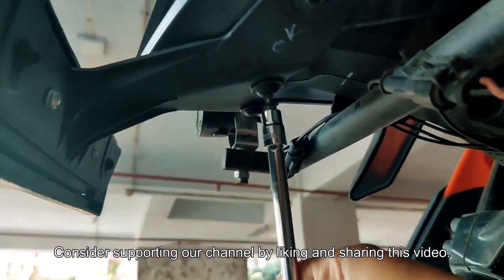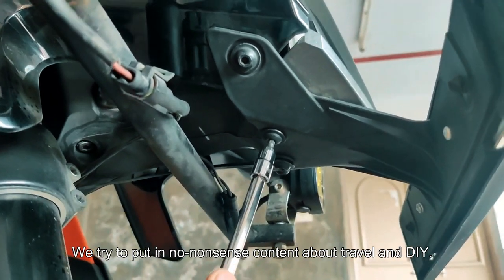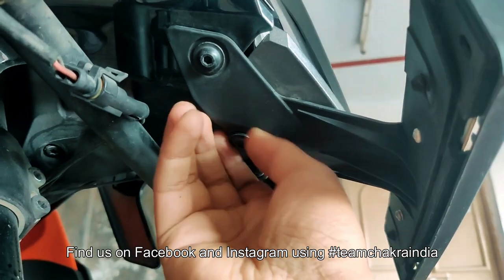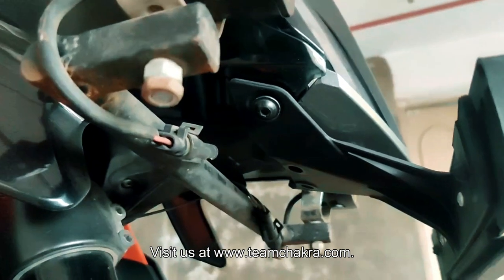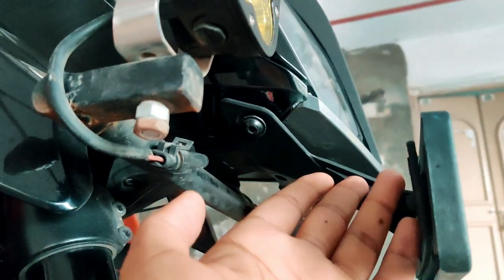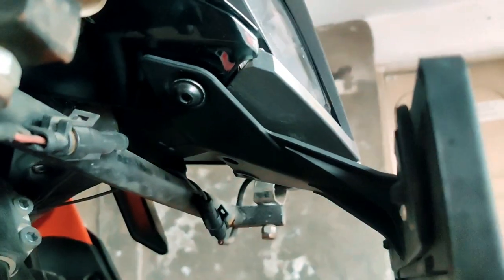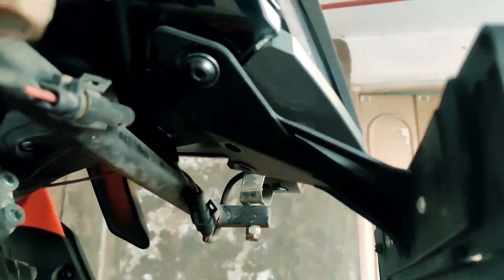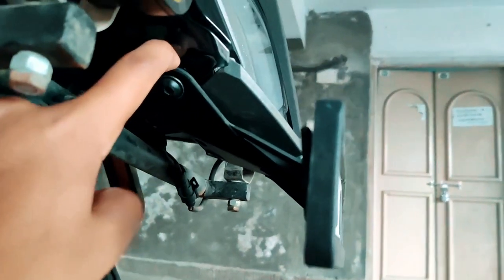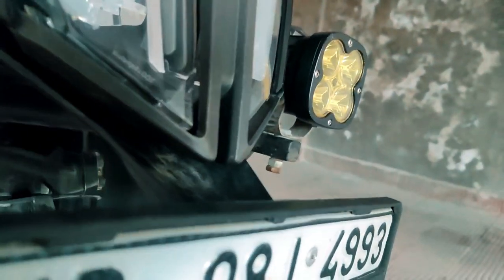These two you need to open completely. After a brief interruption, let's proceed. Once it is loosened, I can probably open it using my hands. Once done, loosen these bolts — this one and the one at the other extreme. I tried opening it and putting in the clamp as-is, but I was struggling to slot it. Keshav from ADV Conquest mentioned he didn't face issues, but I've loosened it enough to get sufficient slack, and I'm going to slide this through the center.